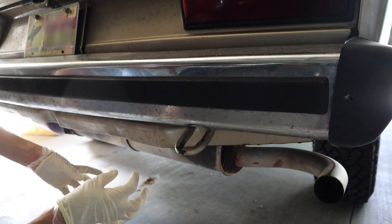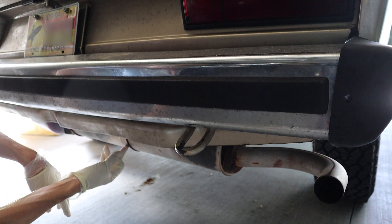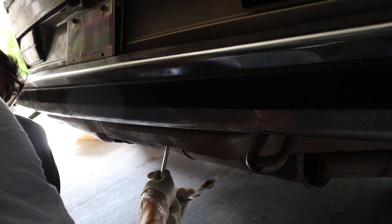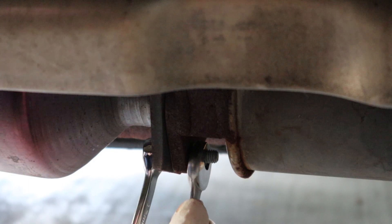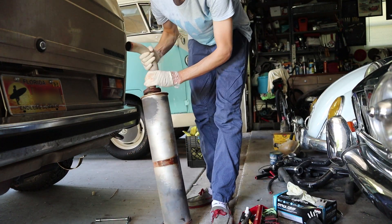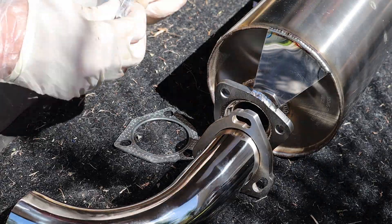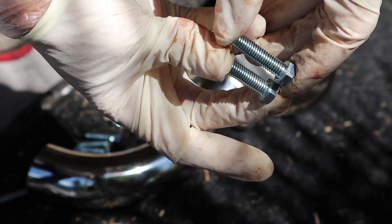I'm thinking that the inside has corroded away and the welds holding the muffler material inside have just gone, so it's just rattling inside. I'll just undo this one bolt in the middle, reuse this bracket, take off these three bolts, and slide it out. Since I had just replaced the catalytic not too long ago, the bolts were relatively easy to remove — usually these things are rusted together. The new muffler was a lot nicer than the old one but also a little longer. The lack of instructions was surprising since installing it isn't as straightforward as it seems.